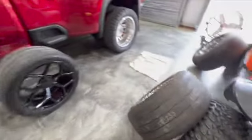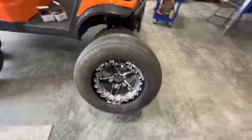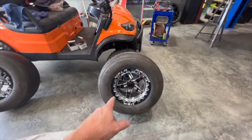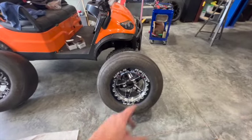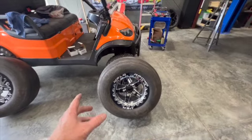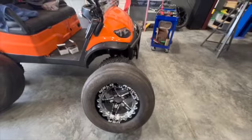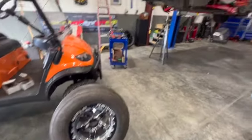Got the wheels finally mounted. Got to torque them things, I think 6 times, man. It's crazy. Start out at inch pounds, 14 and 20 and then 50 and 110. It's crazy. Anyway, a lot of work. All right, we got her done.